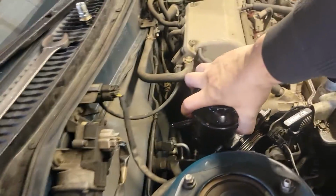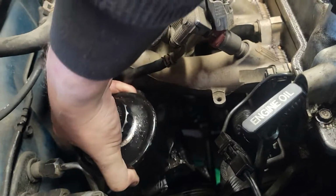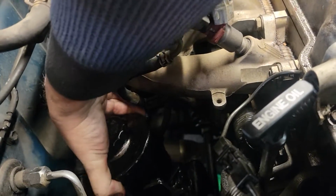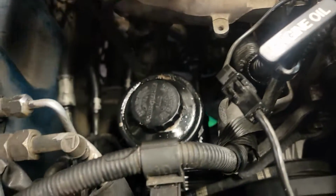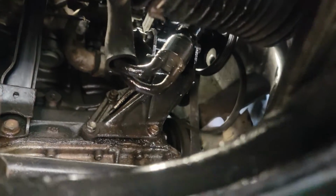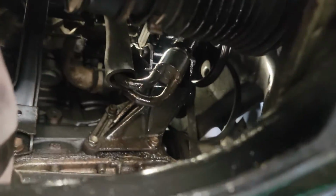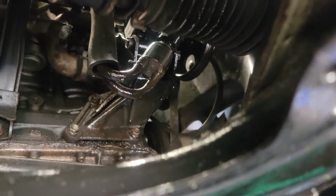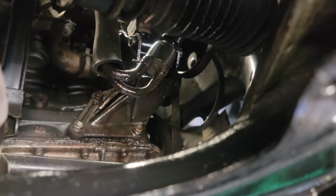All right, once you get your pump back together, you're going to set it down into the hole onto the bottom bracket. And once it's on the bottom bracket, you can pick it up a little bit and put your top bolt in loosely. Once you got the top bolt in, you're able to slide the bottom one all the way through without any issues. And go ahead and tighten that one down, hand tight only.